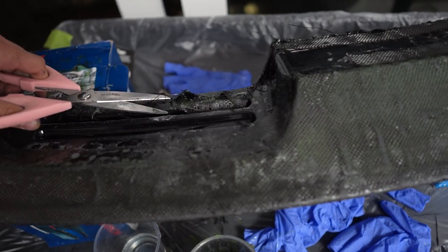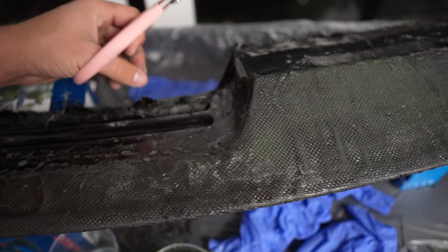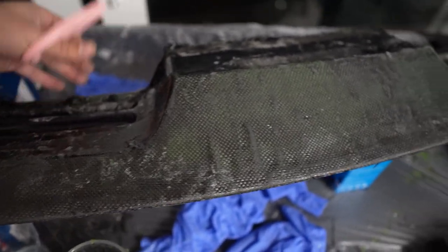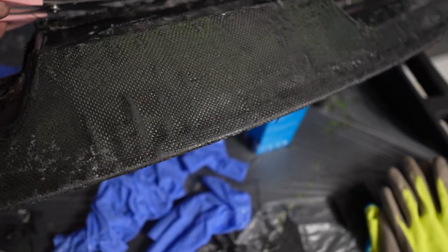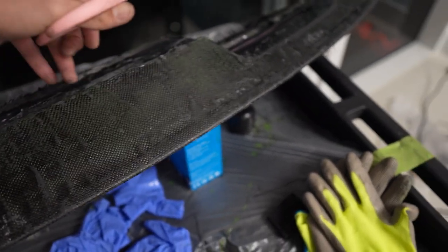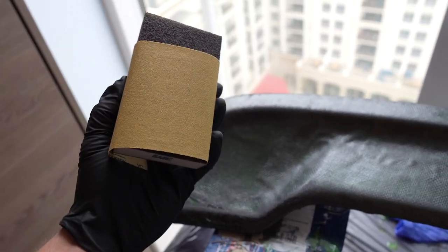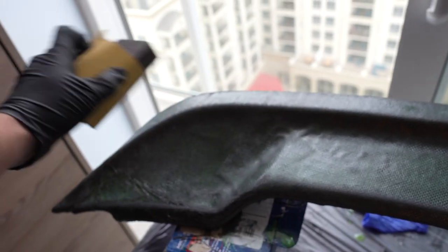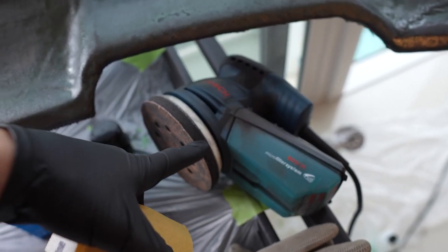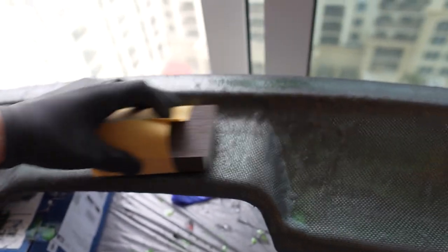I just did some of the underside with more sanding, but I'm also going to get rid of the snags with some scissors. At this stage the resin has hardened completely - it's been eight hours - so these strands of carbon you can just go ahead and snip them. Just go around snipping each of the loose strands like that, clean it up real nice. Then I'm going to take 120 grit by hand with a sanding block and go over the entire wing, because sometimes with that orbital sander you can't be super exact - the pad is a little too big and the angles are weird.